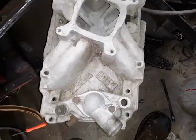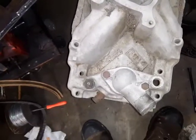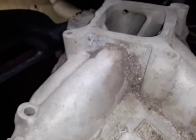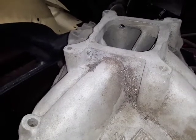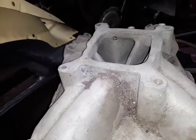And since a few of you seem to like it when I sneak in things at the end of the video without saying anything about it, this is a 70s Edelbrock Torquer 2R, which means Torquer intake, but it's rectangular. And I've not really ever seen very many of these. This is one of those twisted intakes. The only other one I've ever seen is on the Nova, but it's oval port. Straight big runners. Just look at that.